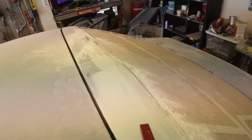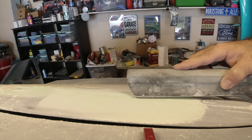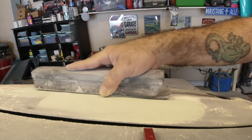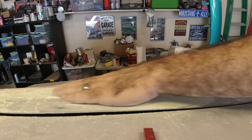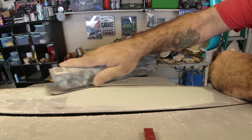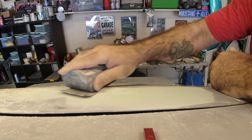So this is what I'm talking about right here. You have a body line that runs across here, and you still have some bondo down here that's not feathered in, but you're getting pretty close. Now's the time I start sculpting my body line and try not to work outside of that — meaning don't pull your sandpaper past the dent. This is how I attack that: it'll sand right down through the bondo, find the body line, and then leave you to the low spot — you'll be able to see it. Let's go ahead and finish feathering the edges. With 120 grit I'm going to start feathering these edges because there's no dent down here — this is where the filler has to be feathered out. It's a lot easier for this sandpaper to do that than 320 that I'm about to switch to.